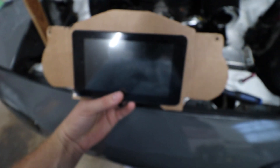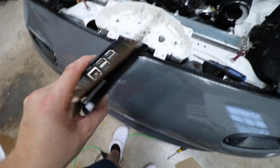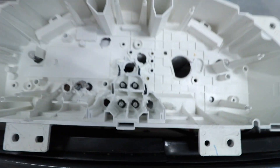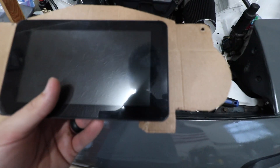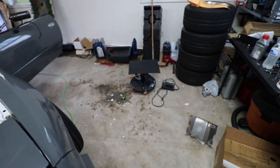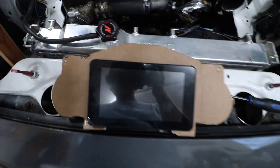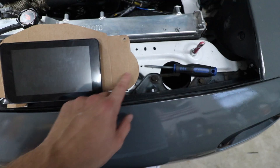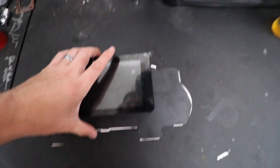Here's a reference - I did a cardboard cutout and you can see that the Raspberry Pi sits in there and sits all the way back. There's this little case back here so I've got to cut this stuff out in the middle. I'm taking this exact cardboard cutout and cutting it out of the ABS plastic so it'll sit just like this perfectly in there, and then we'll put the gas gauge over here and the oil pressure right here.